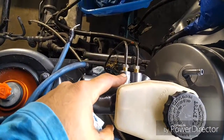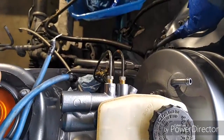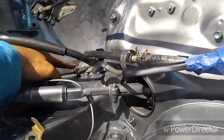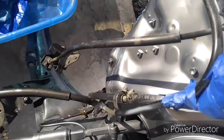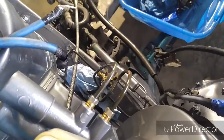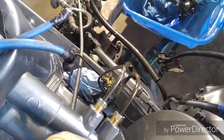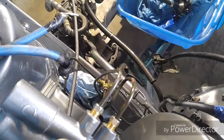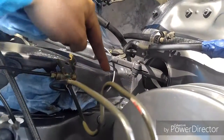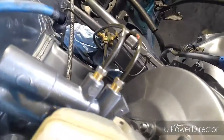Here we are — this is the master cylinder, which just goes to your rear brakes, and these go to the front too. For the rear it was easier because if you look down here on the firewall, that's the stock union that goes back to your rear brakes. It's teed in the rear because our master cylinders have a proportioning valve. So I went to AutoZone — the part number is PAJ351, it's the M10 by 1.0 nuts, 3/16 inch line for Japanese model cars. I bought a 31-inch length, bent it down, bent it around, and connected it there. For the other one you have to tee to the two front brakes — you can grab these tees from any early 90s Toyota, especially Corollas.